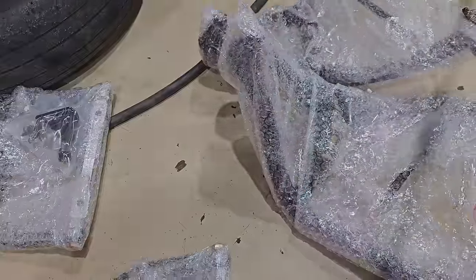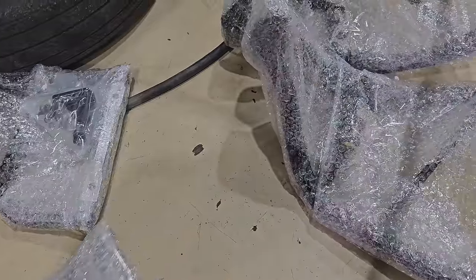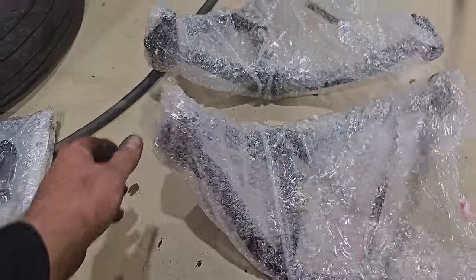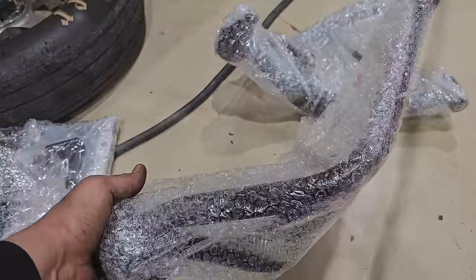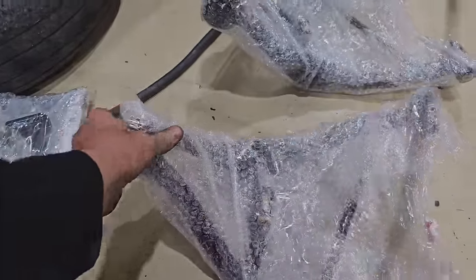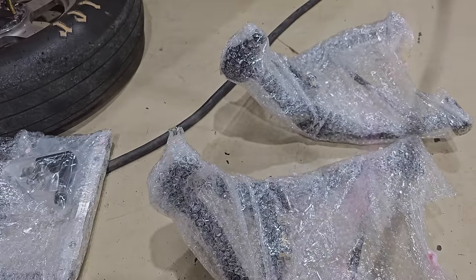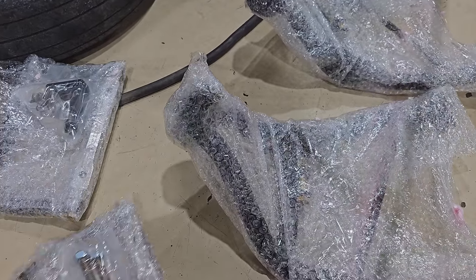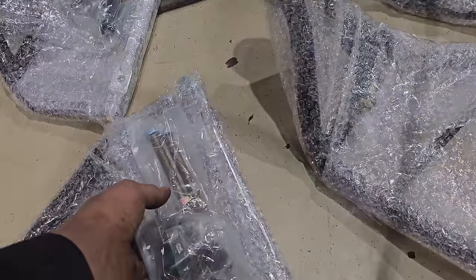It's just guys that did the rear sway stuff and trailing arms, all made in America right here. This is going to not only lower the car significantly in the front, but these control arms are also very low to the ground. So that's something we're going to have to pay attention to, because they're designed to have the front end up for drag racing when you're on the throttle or accelerating. So I just wanted to make sure we had the parts.